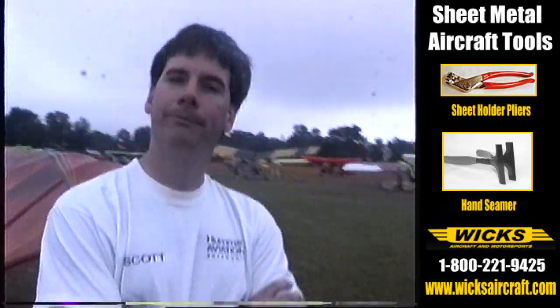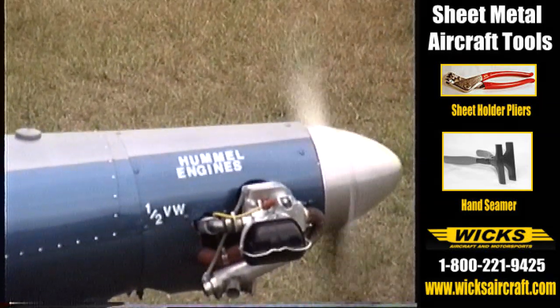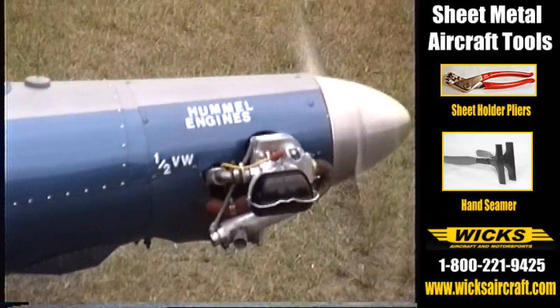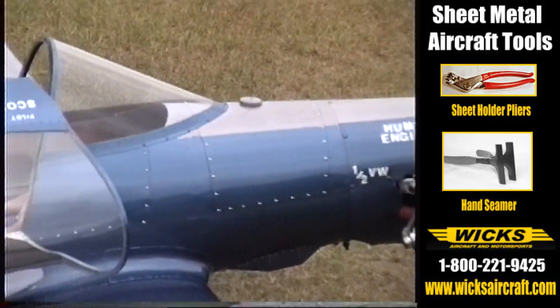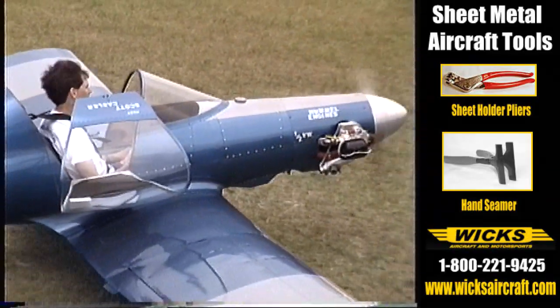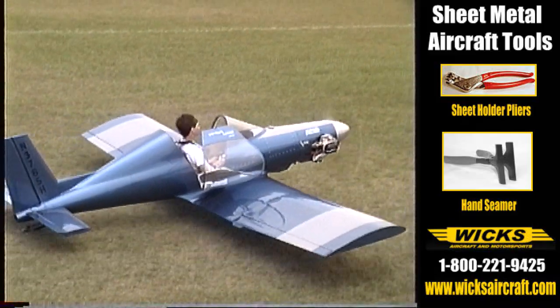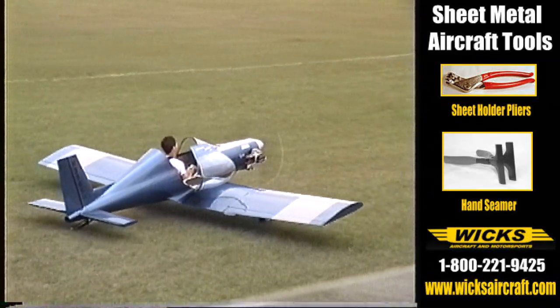Back to you, Scott. We've got this little Volkswagen engine here — you're talking a half Volkswagen. Why not just grab an engine and cut it with a band saw? That's basically what we do. We take a standard Type 1 VW engine, cut off the back two cylinders, weld the case and machine it, put a back plate on it. We offer them in three different versions: standard stroke at 28 and 32 horse, or a stroker with a scat crank getting 37 to 40 horse.